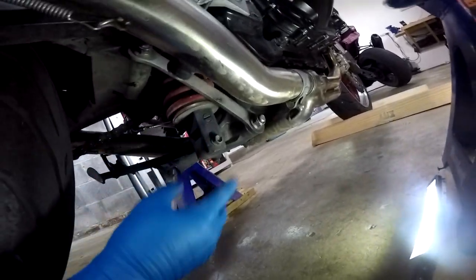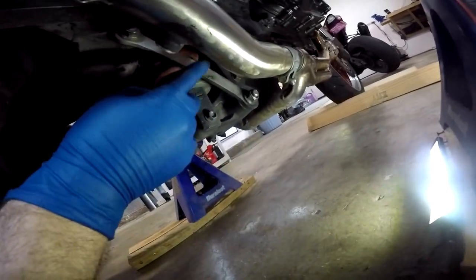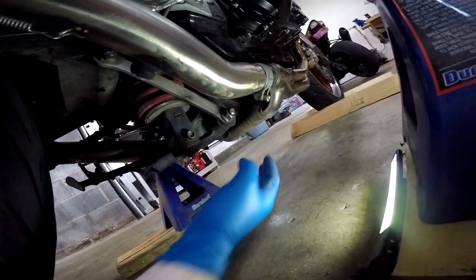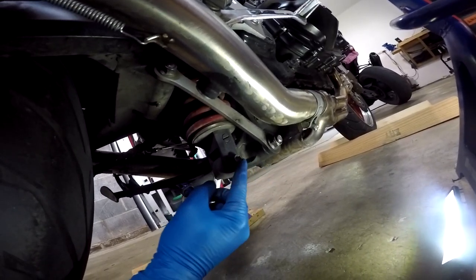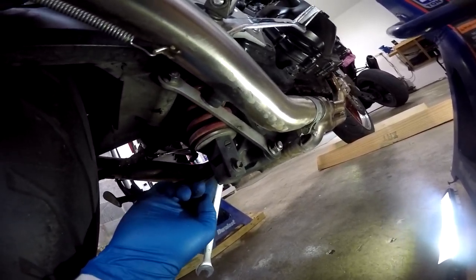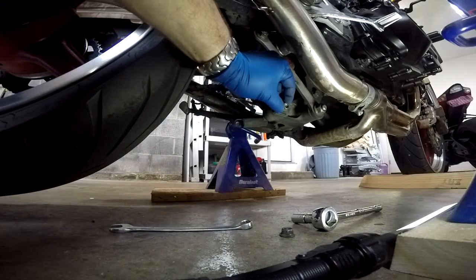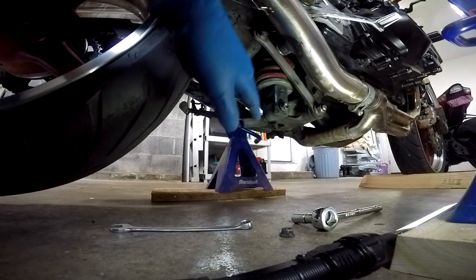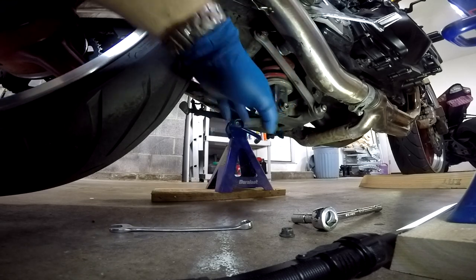Once you get the bike to this point, removing the rear shock is actually pretty simple. You have to break this bolt loose and then that bolt loose, because you have to remove this pivot point from the dog bones. You need to be able to spin it out of the way so that when you remove the bolt at the top of the shock, you can slide it down from the bottom. This first bolt — this side is a 12 millimeter, the nut on the other side is a 14 millimeter. After you take the nut off, you're going to notice that the bolt doesn't want to move. That's because there's still stress on that bolt, and you don't want to try to remove it or you'll damage the threads.